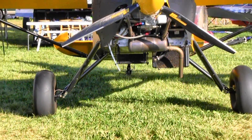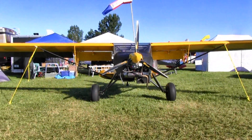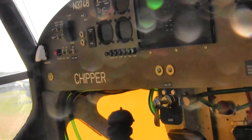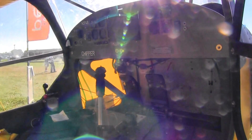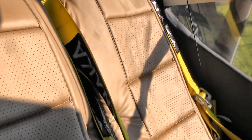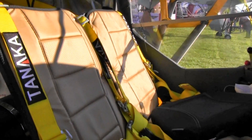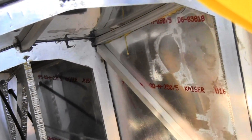So give me some numbers about climb rate on the aircraft. That's the one thing I can't give you a definitive answer on — we think it's greater than 1,000 feet per minute at sea level on a standard day at gross. The problem is it was 107°F in Wichita, so it's hard to correlate density altitude back to sea level standard conditions. But this morning I was seeing around 700 feet per minute on my climb rates, so it's really a quick climber.